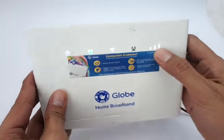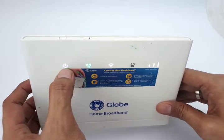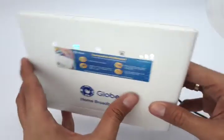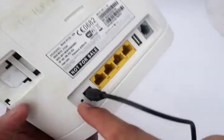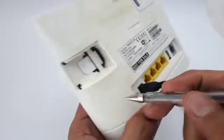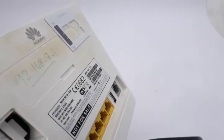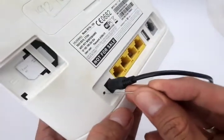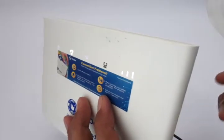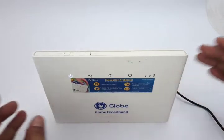Lastly, there's a software problem — when the power light is the only one lighting up, you might need to reset your modem first before reprogramming it. To reset, press the small button in this hole. Let's try it — I have a needle here which can do the trick. I'm pressing it for five seconds and now it's resetting. You have just reset your modem.